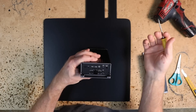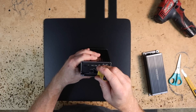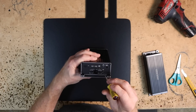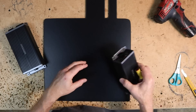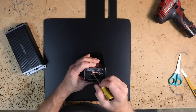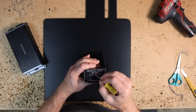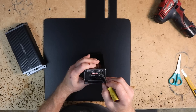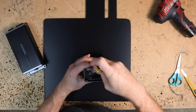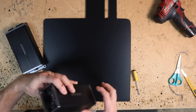Just go through it quickly: gain off, boost off, set your crossover, set your subsonic filter. You have two switches here — high level input, make sure it's set for high level. DC offset, leave off because we'll use the 204 to switch that. Auto turn on, first switch set to DC. Fader set to off. Compression, leave that off. Bi-amp mode is going to be on. Kicker EQ, engaged. Time delay, engaged. For the 6.5s, we're going to go for 80 Hz — that's these first two switches, both in the down position. Gain is zero on both sides. That's pretty much it for the preliminary setup.